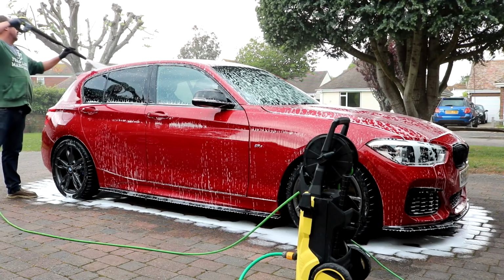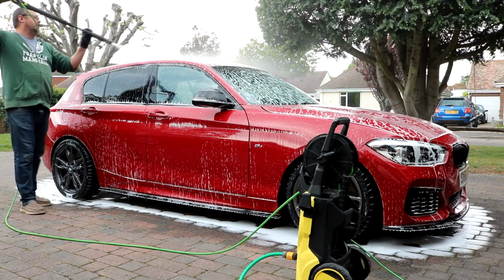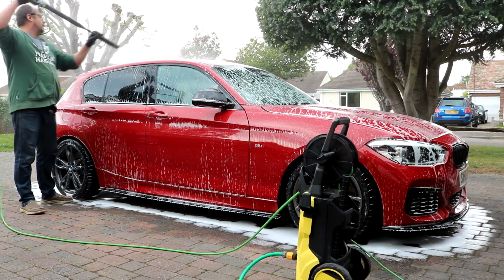Now listen to this. Autofoam is highly active; its cationic nature, positive charge on the hydrophilic end, pulls the surfactant powerfully to the surface and encourages rapid lifting of particulate and oily soils that contaminate vehicle bodywork. Rinsing should be carried out with cold water, as this ensures cleaner rinsing. The cationic is not as soluble in warm water. I love that, because I've learned something. I didn't know that. I love learning stuff about detailing.